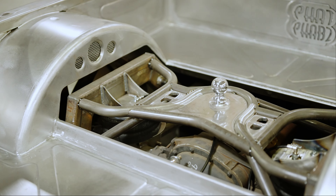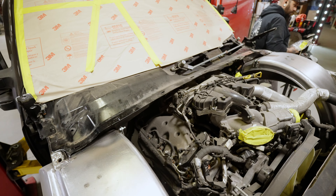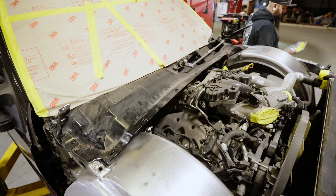The sheet metal in the front is a full front tub that welds into the core support, as well as an outer inner tub so that if the tire over-rubs, we're not going to tear up a tire or a fender — or the paint for that matter. We've got a full driveshaft tunnel and transmission tunnel. You've got to keep that Power Stroke underneath that hood somehow, so there's a little section in the oil pan to keep it underneath the hood.